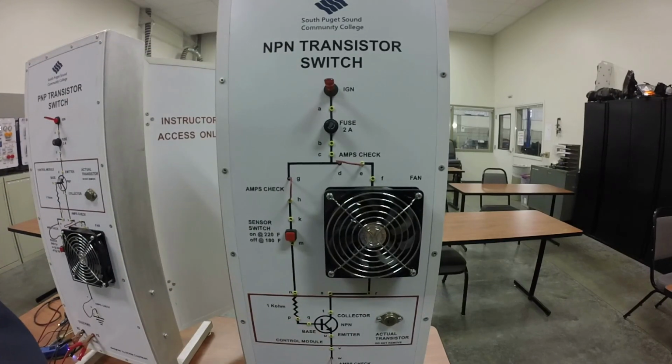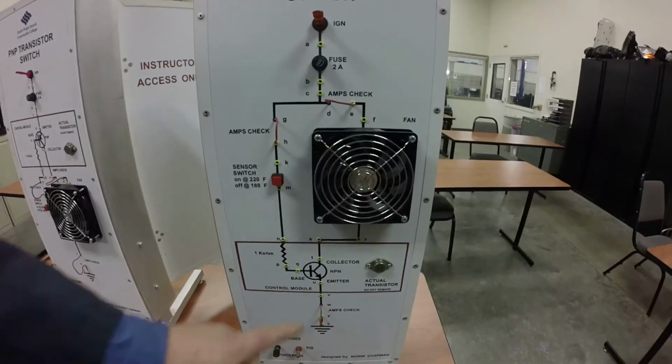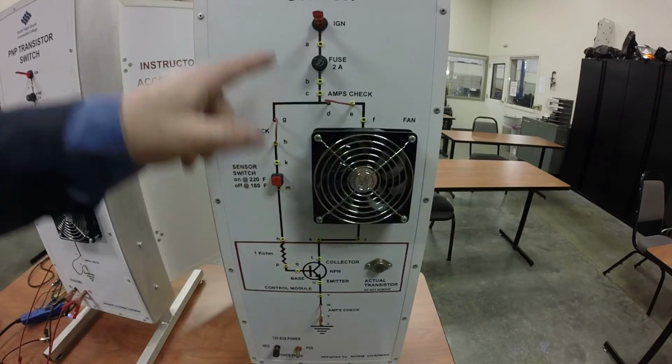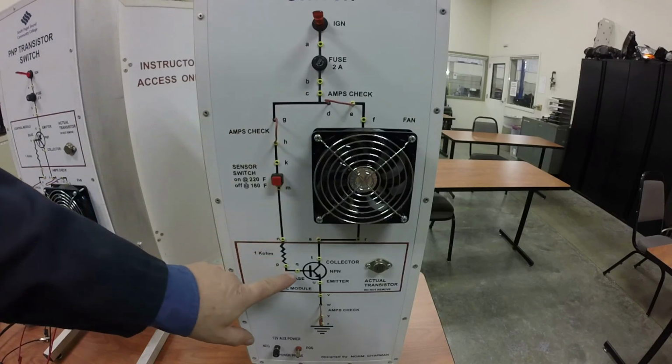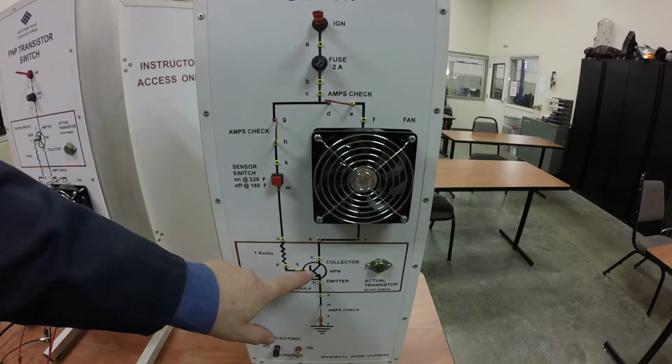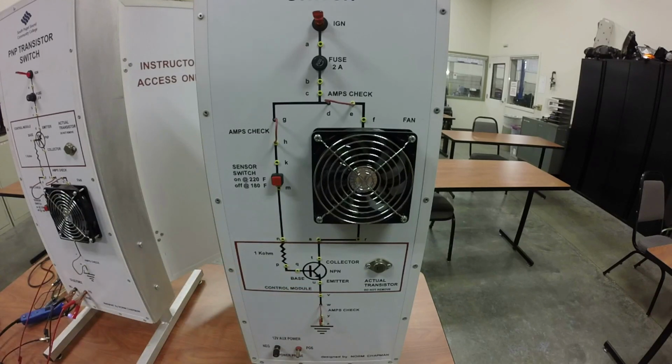So to turn this transistor on, what we're going to do is supply power to the base, because it's an NPN. So we supply power to the base, it turns on the transistor, everything works. So that's the main difference between an NPN and a PNP transistor. Now in the next video, I will actually show you how to build a transistorized circuit.